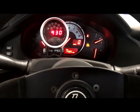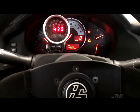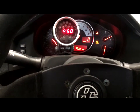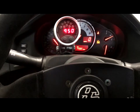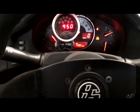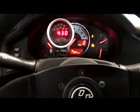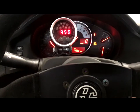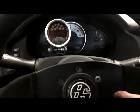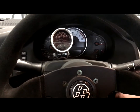This car has a constant check engine light because it's running dual ECU — the FRS ECU is still in here, but it has no readiness and no way of turning the light off completely, so it stays on constantly. There is a GM OBD connector so you can diagnose the engine, but that does not communicate with the FRS computer. So basically you have two OBD ports to do the job.